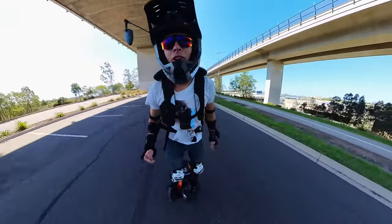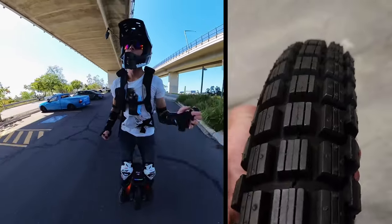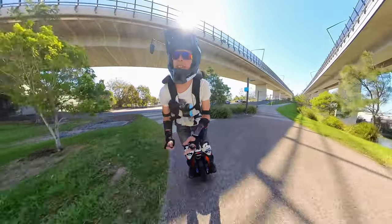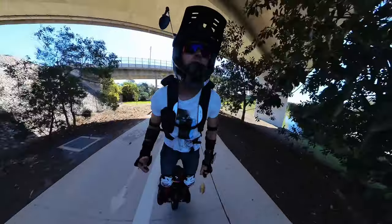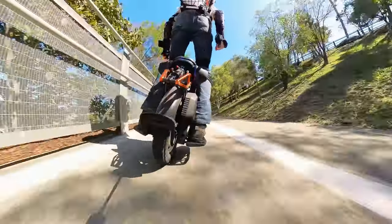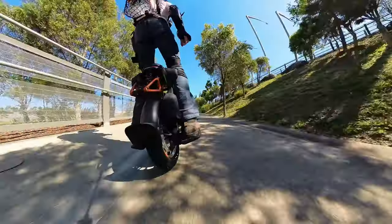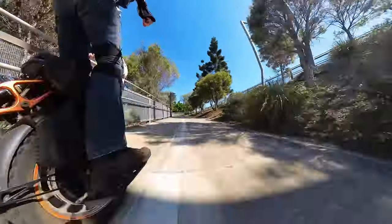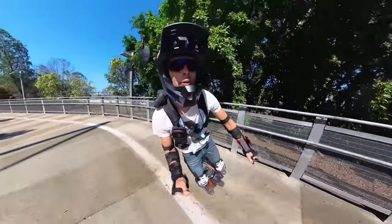There is a narrower rim on this wheel, meaning it rounds out the tire a bit more, and that's just making it easier to carve because when it's rounder it just leans side to side more easily with the knobby tire. It's very progressive cornering — it doesn't fall off an edge like the Kenda K262, which is quite refreshing, and it doesn't have a flat spot like the Extreme, meaning it's quite predictable.